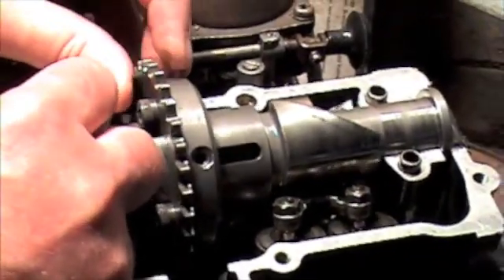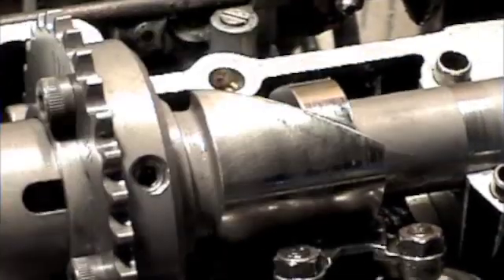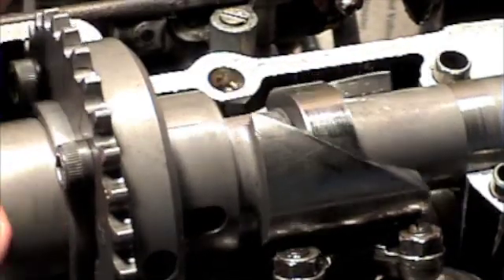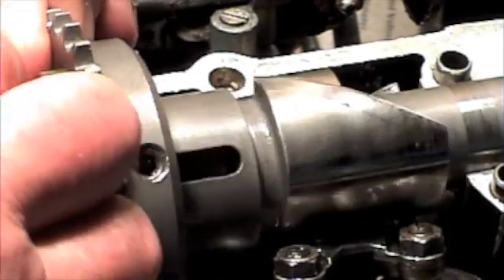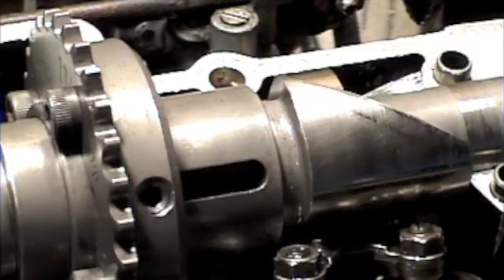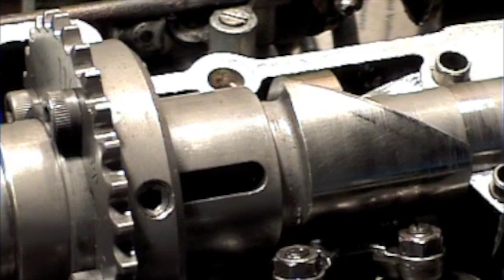If it was done for performance, it would be something like this — it would actually rotate a bit and the lobe would expand symmetrically. Just whether this lobe would operate properly at 15 or 20,000 RPM remains to be seen, but there's a good chance it would. It'll certainly operate alright at around 10,000 RPM, so it probably seems likely it would operate at 15 to 20,000, and maybe even more.